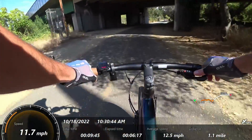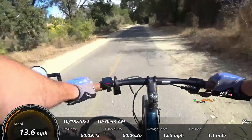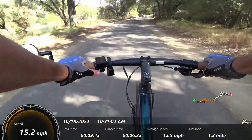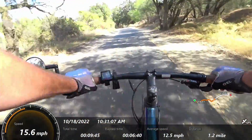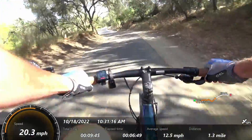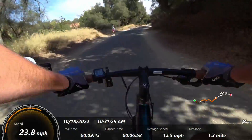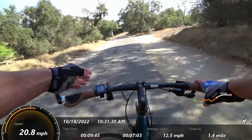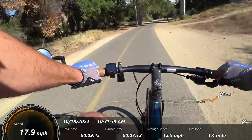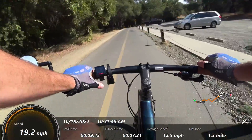I have a little bit of an empty stretch of path here and I'm going to show you how quickly this can respond. I'm in boost mode, highest gear, and I'm just spinning my legs — not breathing hard — and I'm maintaining about 17 miles per hour according to the display. Everything is clear; I'm just going to push a little bit. Because this is torque-based, when you push it kicks in right away. I can hit 28 miles per hour by this display, actually a little bit over. The effort — you do have to put out quite a lot. A moderate amount of effort, you can really maintain around 21 miles per hour without too much problem at all. The bike path I'm on has a 15 mph speed limit, so I'm going to settle back in.